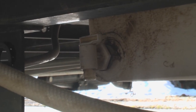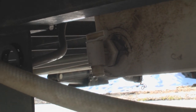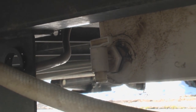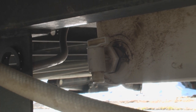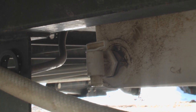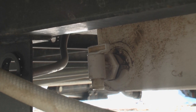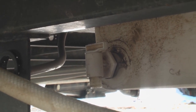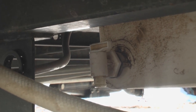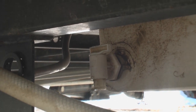The last thing you'll definitely want to winterize is your actual water reservoir or holding tank. I always drain mine after every trip, but if you need to, simply turn that knob 180 degrees and all of the water will run out of your camper as well as out of the inlet hose that goes from the reservoir to the water pump — making sure you have nothing but air within that hose, since we did not put antifreeze in it.